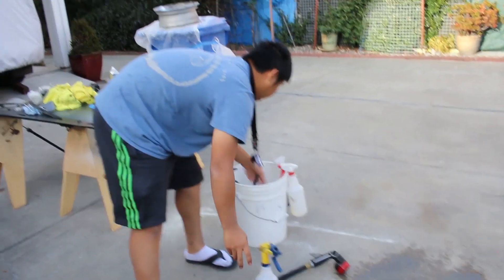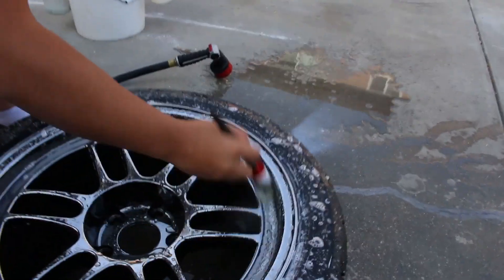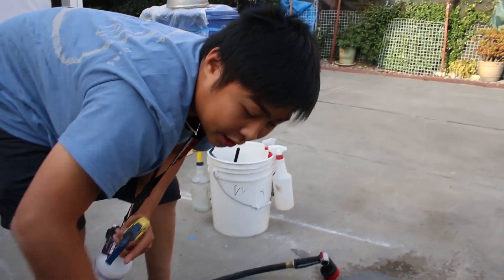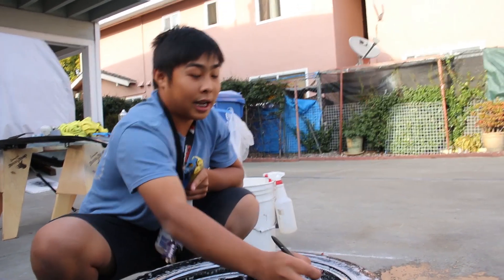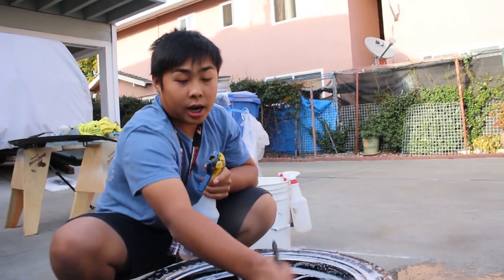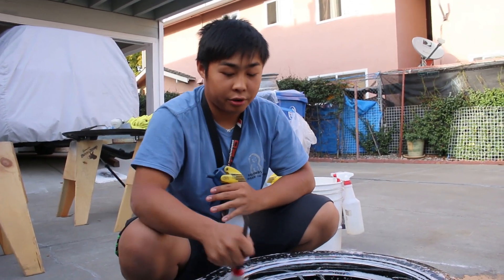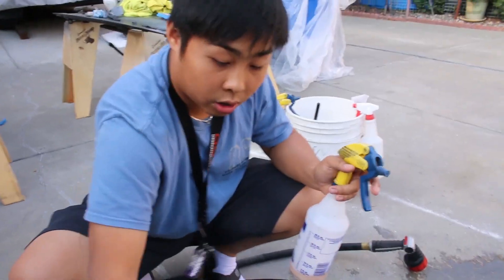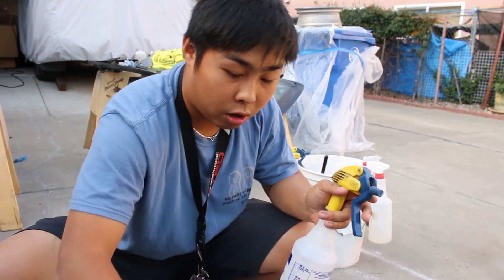For the job you can use a detailing brush. I need to get some new ones, but I clean everything. You want to be really careful with the stickers — put the stickers on before you ceramic coat because they might not stick afterward. That's also another reason to get your tires mounted first, because wheel weights won't stick to ceramic coated wheels. For this cleaning process there's nothing really special — just get into all the nooks and crevices. You're mainly just cleaning up the lube used from mounting the tires, and we're going to do an alcohol wipe-down after this.